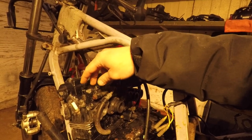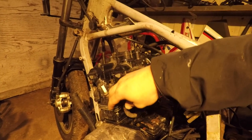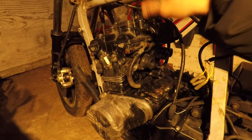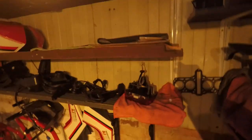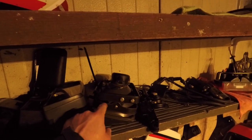Tomorrow I'll try and start taking the cylinder head out, check all the clearances, take the cams out, then take the head out, check the valves, clean them, and put it back together again. I'll also take the cylinder out, then the whole engine will come out of this bike. I moved the drill so I can have more table space — almost two metres of table. This is the space for parts I'm actually going to use on the symbiosis bike.